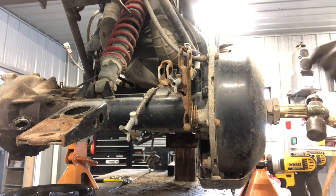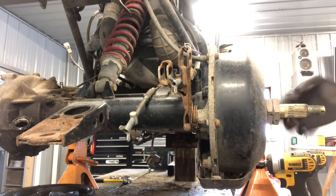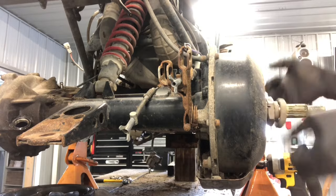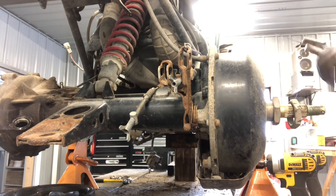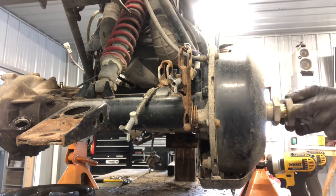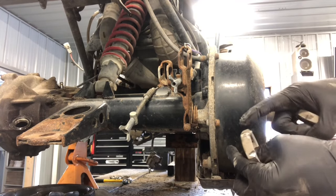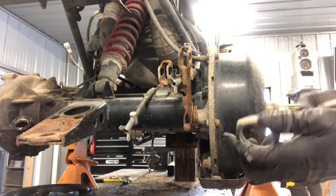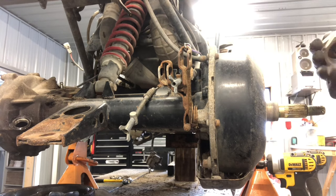The mark on these nuts is just so you know you're making progress. If it moves even slightly, you know what you're doing is working. You don't have to make the mark, but it makes it clear whether you're moving at all. Once you get them loosened up, I'll grab channel locks — that goes a little faster than tapping and doesn't destroy the nuts. Then I put them on a hard surface and tap down the areas I've chiseled. Most of the time they're not damaged enough to need replacing, though you can obviously replace them.